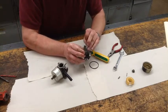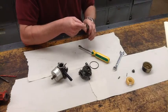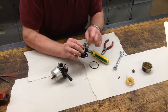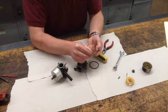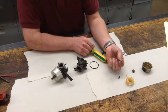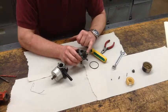I fit it through the hole — I'm going to redo it since I didn't cut off enough. I'll bend it again at 90 degrees and this time cut a little bit more off so I can actually get down through the hole. I fit it through and pull it out, and there we have our seat. Now when you put these seats back in, there's two sides: one side has a rib to it, and the other side has a small number stamped in it. When you put it down in, you put the rib down.